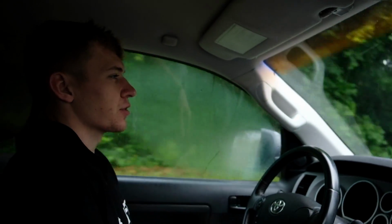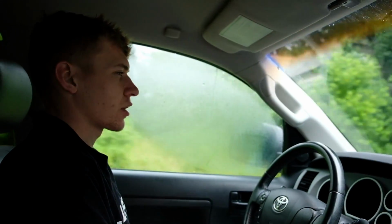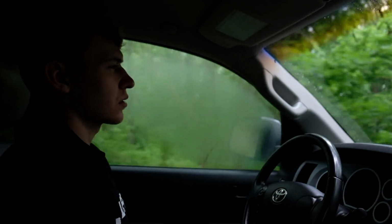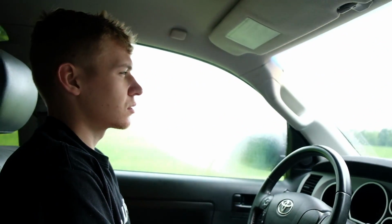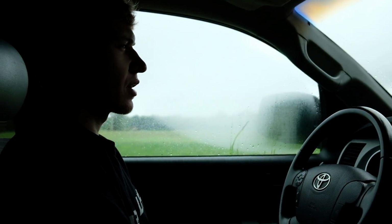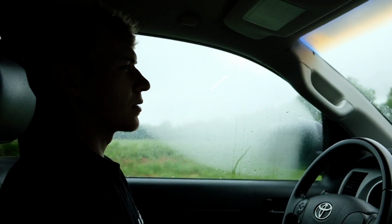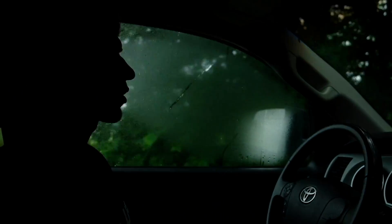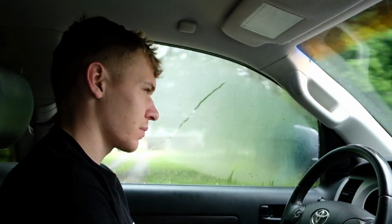I'm not opposed to doing that because I'm not happy with the pistons that are in it. The coating is coming off the skirts on the side and it's scoring up the cylinder walls. So, I'm not crazy happy about those pistons. And I might even put some compression back in the thing to make it run without having to push so much boost.